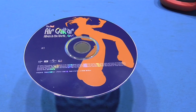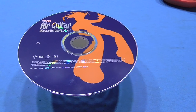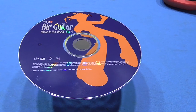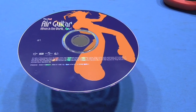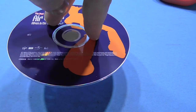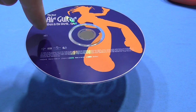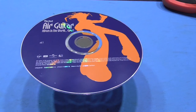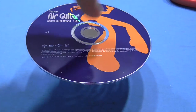I just want to explain why I read the outer edge of the CD when calibrating a laser. The outer edge of the CD is the most difficult part for a CD laser to pick up. The reason for that is — when you pick a CD up, you're normally touching it with your fingers. Also, if you ever look at a CD side on, you'll get wobble like this. If the laser's here at the centre it's not very pronounced, but the further you get out, the more exaggerated that wobble becomes, making it more difficult for the laser to pick up. So that's why I always calibrate on the outer edge — because if you can get it to read the outer edge fine, the rest of the disc is not going to be a problem.